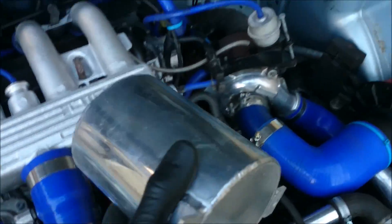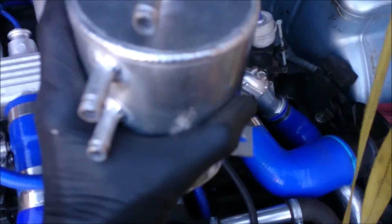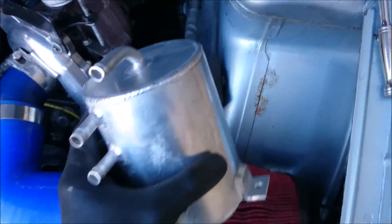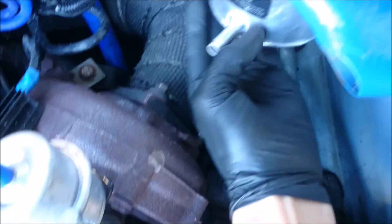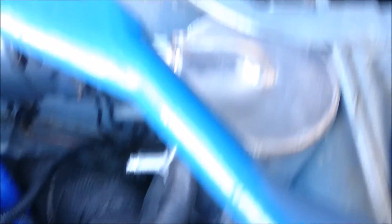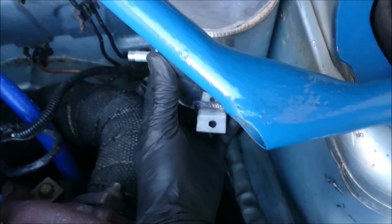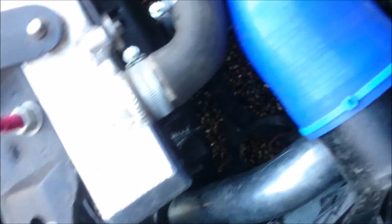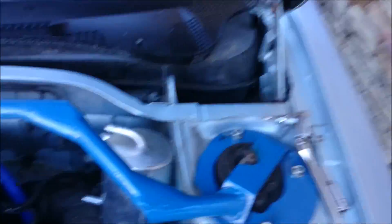I had the fuel filter down there and it might still stay there. I'm looking for a location — we're worried it might get a little bit warm. It's a nice alloy so it will deflect heat and won't warm up too badly, but we might need to put a cooler in line. The only spot I've got is down here which is a bit of an issue because there's an exhaust manifold right there. I want to run the fuel lines up through the cabin. We'll make a little bracket and fit it in that corner. If it gets warm, we've got direct access to the front for a cooling duct, and we have the option of fitting a fuel cooler — just some copper pipe with a cold air feed.